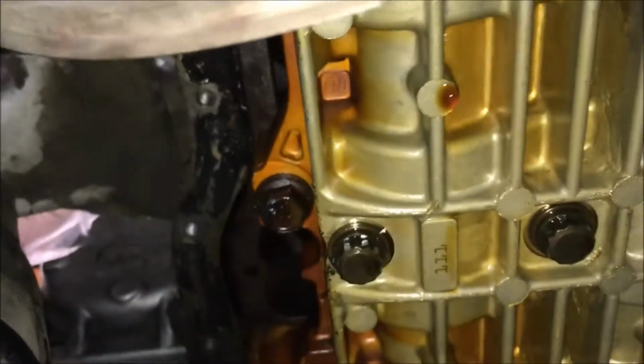All right, y'all, the plate is coming down now. This little guy. Here's what happened. It would not come down, wouldn't release. Why? The last person who did this job adhesed it. That's right, they did. So if your plate right here is not coming off, the plate with the foam on it right there, you're gonna have to use a putty knife to remove adhesive, because perhaps somebody did it and glued it to it. I'm going to slide that plate down so those pegs are no longer in the way. The pegs hold the foam on, and then bring that pan down. All right, y'all, the pan is down. That's what it looks like underneath.